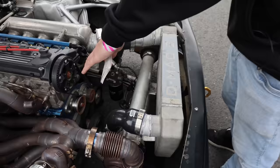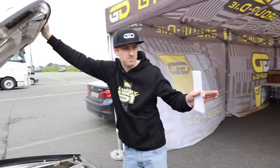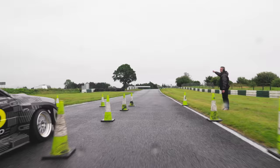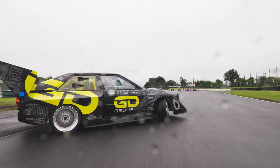We could move it back because we have no front driveshafts — it's just a regular rear-wheel-drive sequential gearbox. And it actually has a Silvia rear subframe in it, which might be cheating a little bit. But we've learned from experience — like with the Need for Speed Corolla we went fully bespoke, and it's more of a pain than anything because you have to carry bespoke spares. Whereas this car and the S-chassis car share very similar suspension components. You can replace an upright from one car to the other. So now we try to keep them the same — this is the primary vehicle and the secondary vehicles mirror it, so we only need one spares package.